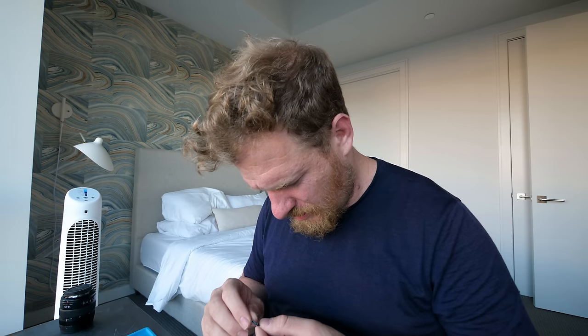Electrically, the headphone jack should be exactly the same between this model and the 7. I see absolutely no reason they would be different. I feel fairly certain that this piece of plastic is unnecessary — you totally don't need it. Well, you need it if you want your phone to be waterproof, but I'm not going to worry about that as a constraint. It's possible; it's just a lot of engineering work. I think USB-C is very possible, and the question is do I have enough vertical space? There is a chip here that you'd have to worry about — that might be a problem. But there's some possibility here.